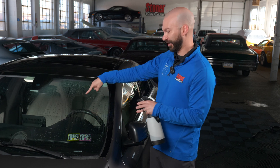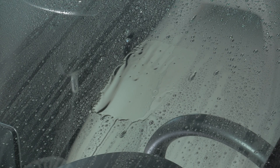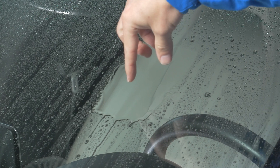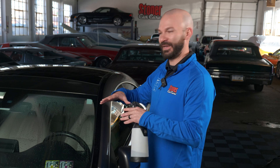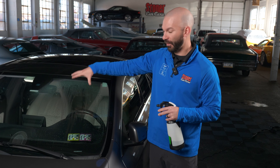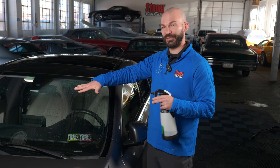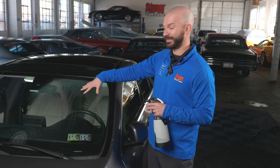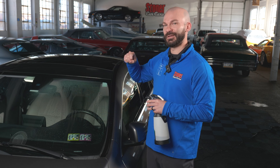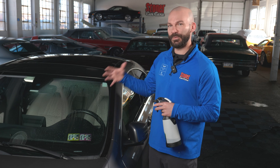On film sometimes it looks like this hydrophilic sheeting is actually clearer and easier to handle, but as soon as you get any wind or you're driving in the real world, it's going to be terrible to look through and terrible on your paint. The only benefit is it dries evenly. One downside of hydrophobic surfaces is water spots, while a hydrophilic surface distributes water over a much larger area — but dirt and minerals are more able to stick to it.